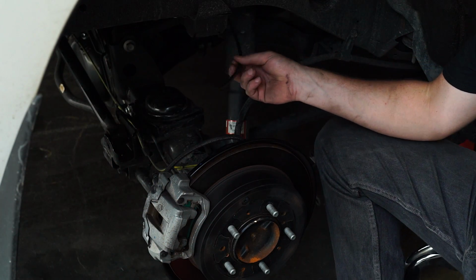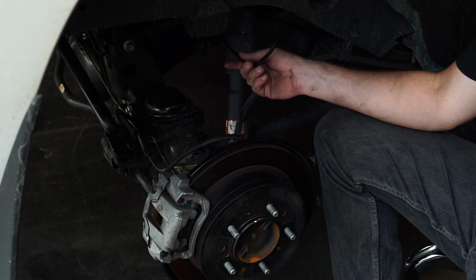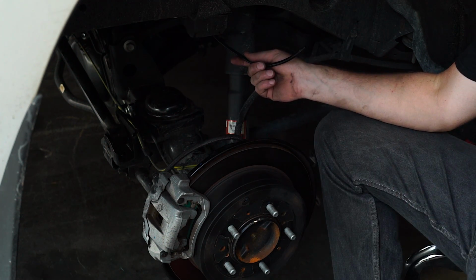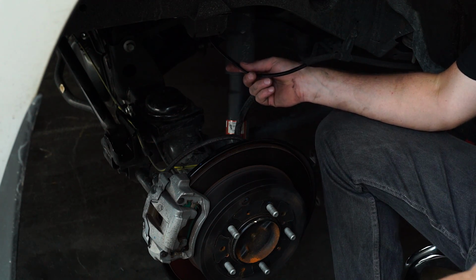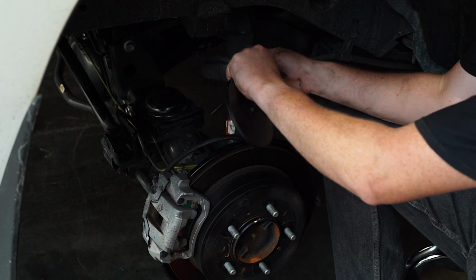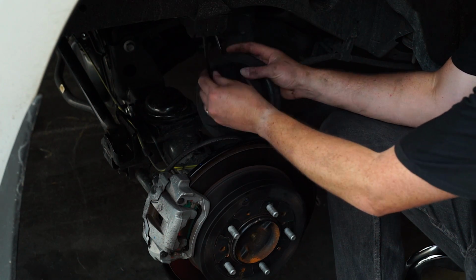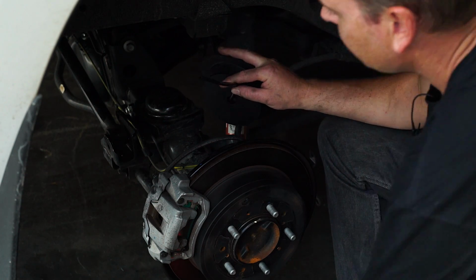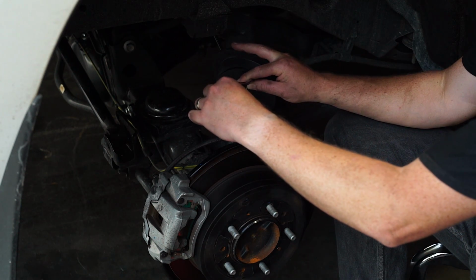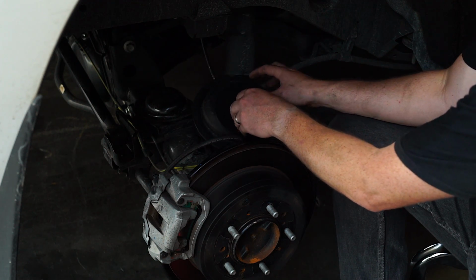Okay, so we've got some excess airline hanging down here. We've run the airline both left and right, basically where we want it to go, and we'll fine tune that later with some cable ties into place and some split tubing. But what we'll do now is run the spring seat back through the middle here, run the top cap of the airbag through there, and also run the coil spring over the airline as well. We'll just let that rest there.